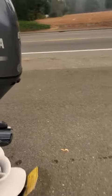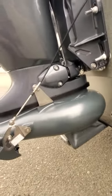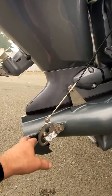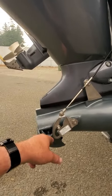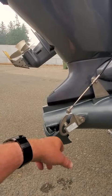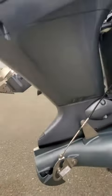And here's the jet — I think it's too high. If you look at the shoe here, we'll see it needs to be lowered. He did put a splash guard on it. Reverse bucket, the nozzle here, the reverse bucket itself. In reverse, it's not lined up. Forward, at least it locks — that's more important because you don't want that to blow out. But if you hit it too far, it could back out in reverse, so we'll see.